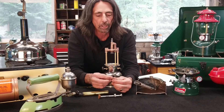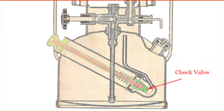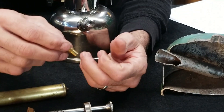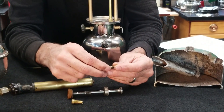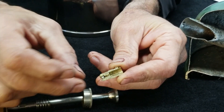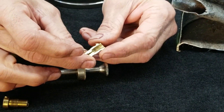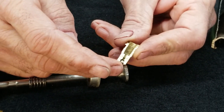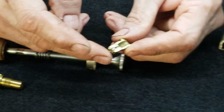The first piece that goes with the pump is the check valve. The check valve is a device that allows air to flow in one direction only. You'll see in this lantern that down at the bottom is where this device sits. As we pump our air down, it will allow air to flow into the fount, but it won't allow air to come back out. Inside the check valve, at the bottom, there is a small check ball that is free to move up and down. If it is down, air is allowed to go past that little check ball. When the check ball returns up, it is blocking the check valve and no air can flow through it.